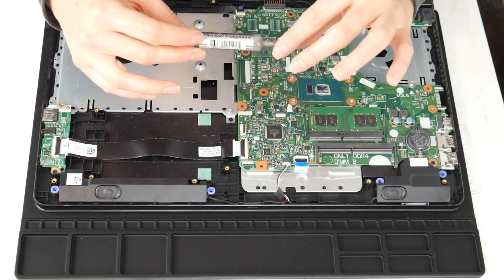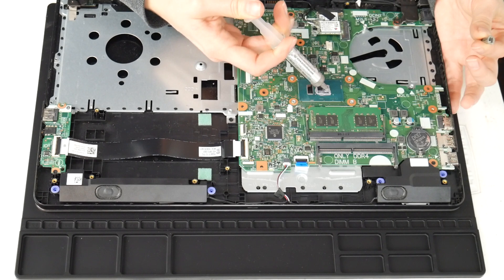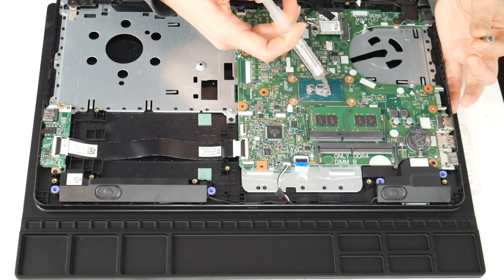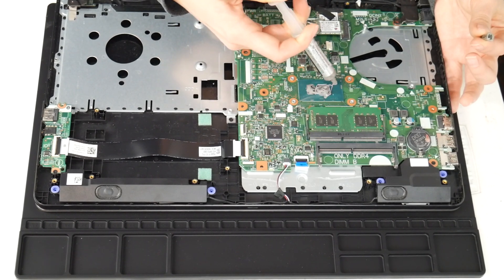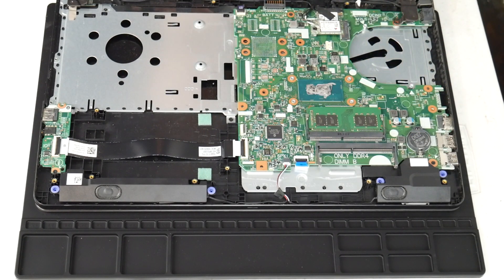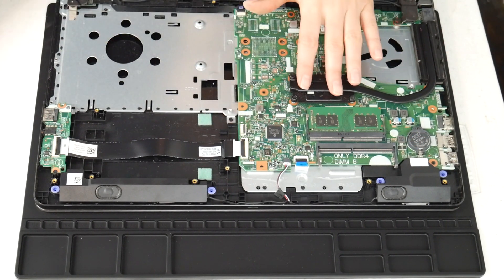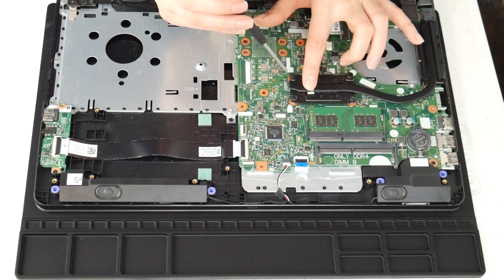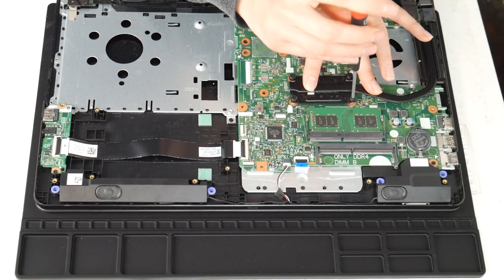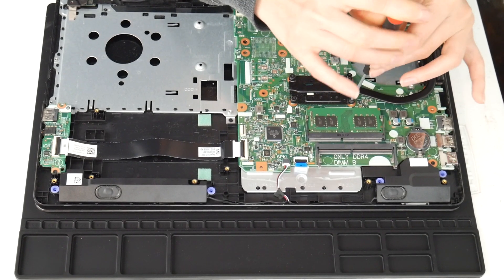The next thing I'm going to do is use some thermal paste on the CPU. I forgot to clean off the CPU before doing this, but I do recommend that. As you can see, it's dried out and there isn't much on there. So I go ahead and put some new thermal paste. I've included a link down below with some good quality thermal paste, because not all thermal paste is created equal — you've got to get the good quality stuff. Put your heat sink back on; there are four screws and it's kind of like putting a tire on. You have to go one screw and then across to the other at an angle so that you don't get one side tighter than the other.